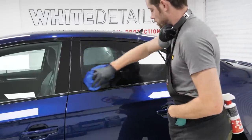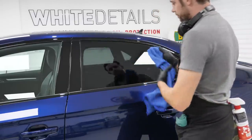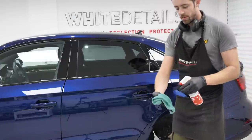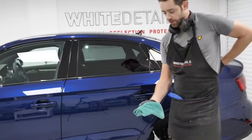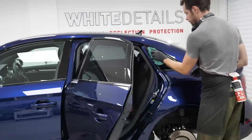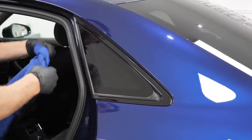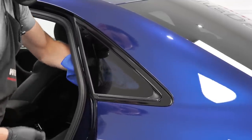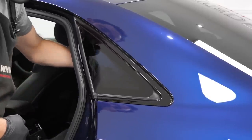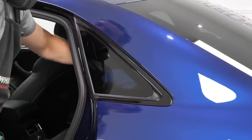1, 2, 3, 4. On, one very fast wipe over before doing a more thorough buff after turning the towel. Hopefully you can see why at this point you wouldn't want to spray directly over the glass, because you're going to get overspray onto the paint in the adjacent areas, which are now nice and finished. Of course, if you can't get a finger down to the very bottom channels, which you can, you could always improvise with a wooden skewer or some sort of plastic skewer to push the cloth deeper into the crevices.